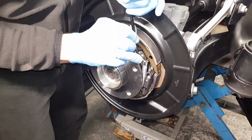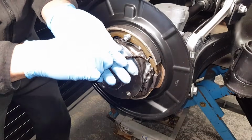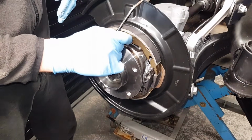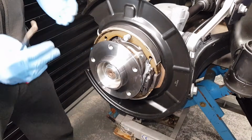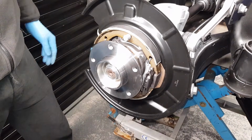I'm going to try and lift the top, insert it in place, and then push it in. So this is now perfectly in place. Everything else, all these spring loaded pins, are in place, and now we can safely install your brake disc, your caliper carrier, and the calipers, of course, as well, if you wanted to do that at this point.